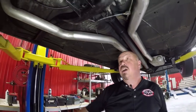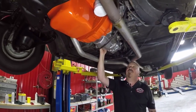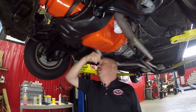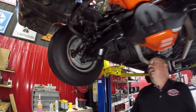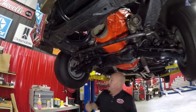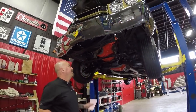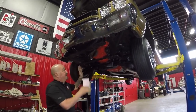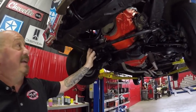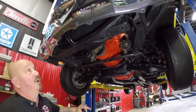We do have the correct trans in this thing — the build date on the trans is exactly correct for the year. We did not find the VIN number stamped on the trans, but all the dates line up perfectly. The motor is numbers-matching and we did find the VIN stamp on the motor. The brakes look original, everything looks nice and tight, new shocks were put on, and we still have even the tags on the springs — those look like the original springs. Big sway bar, core support looks good, bumper looks original. The only thing done to this car is the motor was cleaned up and dusted with a little bit of orange paint — very factory correct. It's also had a new fuel pump put on it.